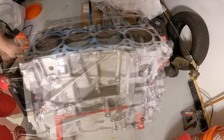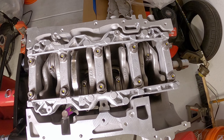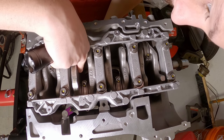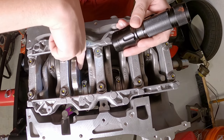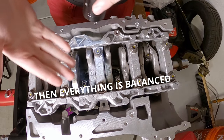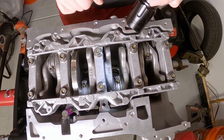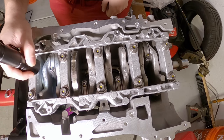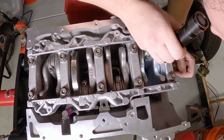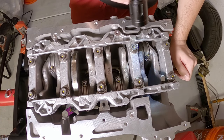Here's the business end. I'm pretty sure they used a stock crankshaft. Over here is machined - this is the gear to the balance shaft, they actually machined off all the teeth. I thought they were just going to leave the teeth on there but to my surprise they went through that trouble to machine it. And we've got nice beefy H-beam rods, forged pistons - they look really solid.